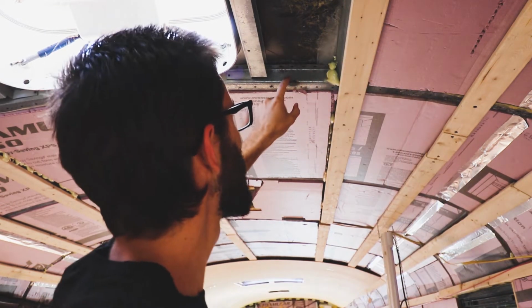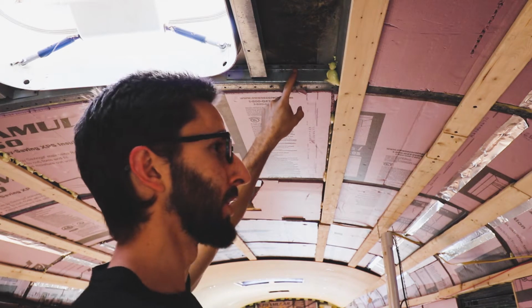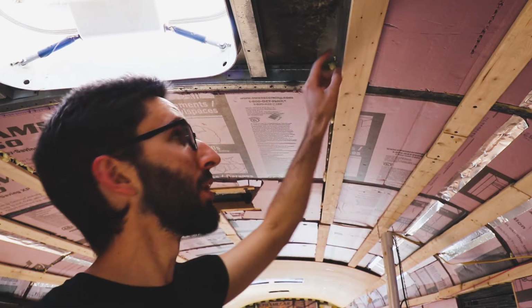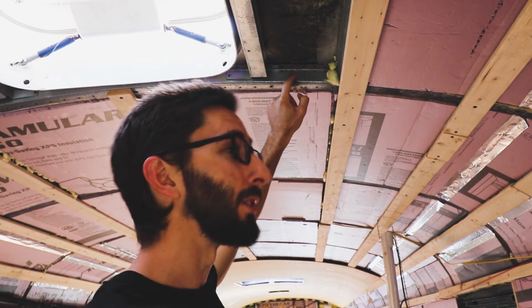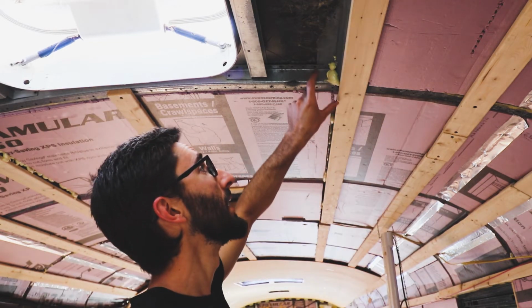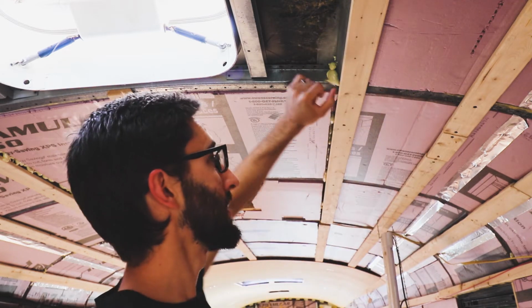But people are putting their furring strips along their bus ribs, so they're screwing like 90 holes throughout the sides of the bus, and that actually weakens the metal and the structure by quite a bit. If I've got a 7.5 foot span, I'm gonna put at least 20 extra holes into this rib. God forbid the bus rolls over. The structural point between each one of these weakens quite a bit.